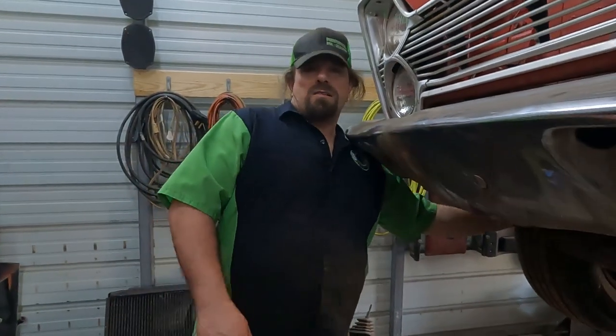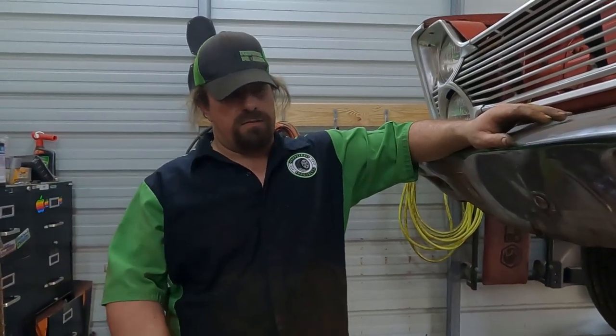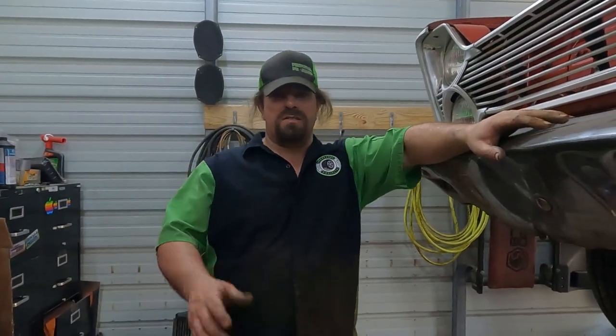We got all of our wheels and tires on, got our brakes all adjusted. I just adjusted them up till they had just a slight drag. You've seen the condition of the drums. They're gonna clean up after the first couple brake applications. Everything should seat right in and be just fine.